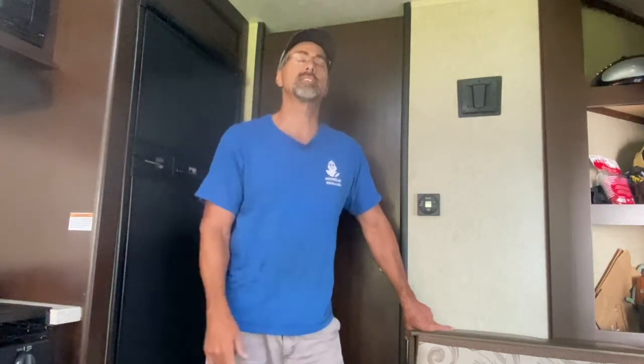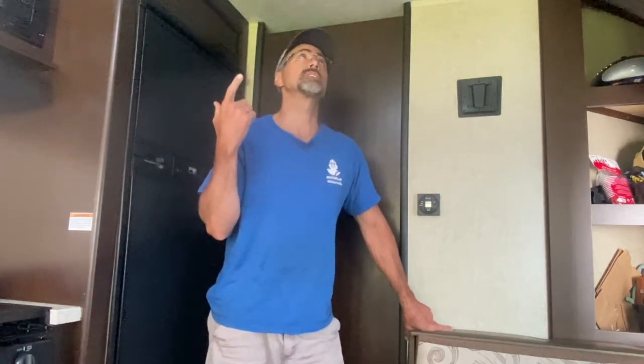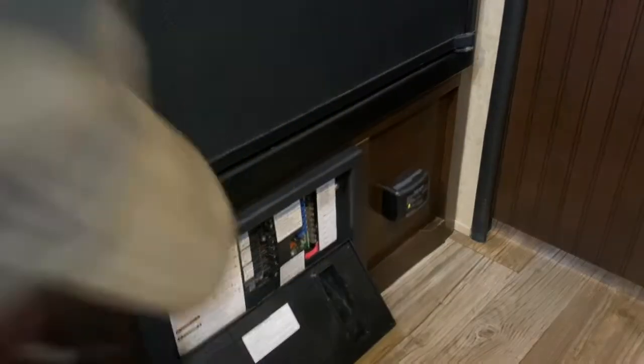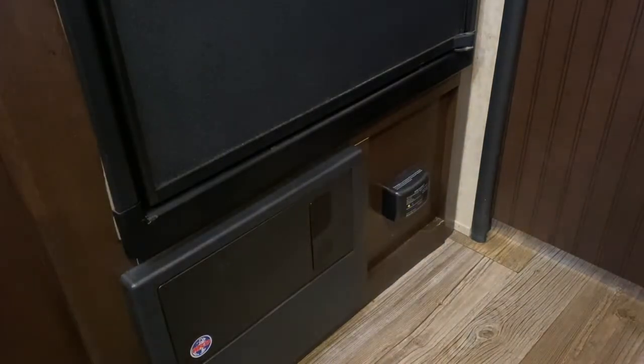Welcome back to the channel. Today I'm going to show you how I replace my AC on my camper. I have a video on troubleshooting this — I'll put it in the comments below, have a look at that too. I'm going to shut off the circuit breaker for the AC — it's the second one down, says AC on it. Just a 20-amp breaker, so I know there's no power for the AC unit.